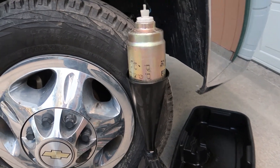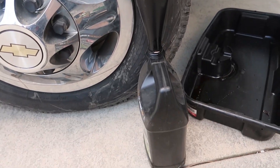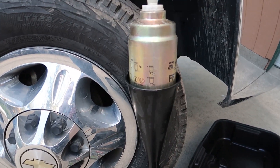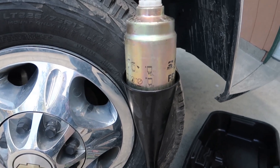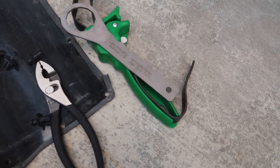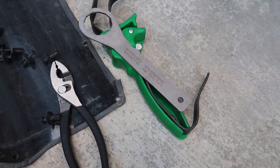After I have the filter out, I tip it upside down in a long funnel and place that funnel in a bottle and allow the diesel fuel to drain out. Then I get a specialized wrench — which is right there — that I actually bought from the same place I bought the fuel filter access door.